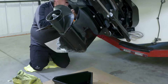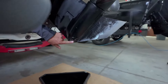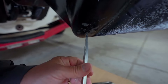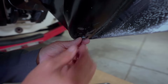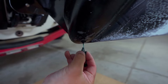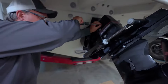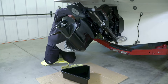Get the oil pan in the proper position. Keep the oil vent just snug so it keeps the oil from coming out. Here is the oil drain plug — make sure you have a big screwdriver so you don't strip it out. Slowly start to turn that out. I like to grab it as it comes out so I can inspect it, and there should be a seal there. Looks pretty good — nice and clean.